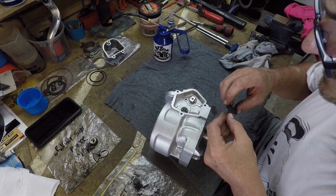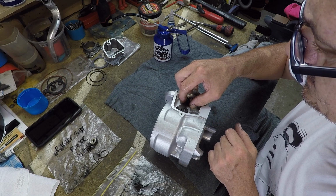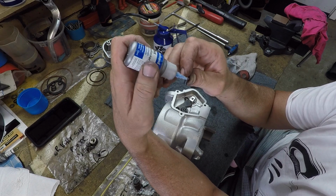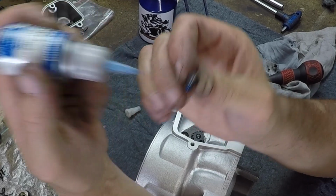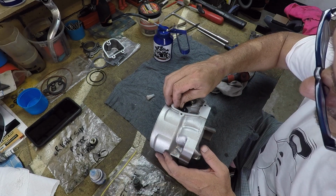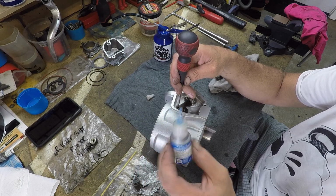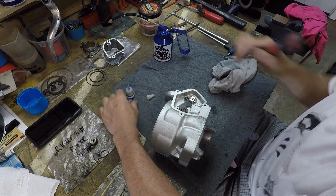Okay. So I need now that little retainer with some Loctite. From experience, I have been made aware that when you're putting Loctite on a bolt, just let it drip on. You don't want to touch the tip of that onto the metal, because that's kind of the catalyst that begins the drying of the glue. If you start rubbing the tip of your thread lock against metal, it dries up in the tip and your bottle doesn't work anymore.